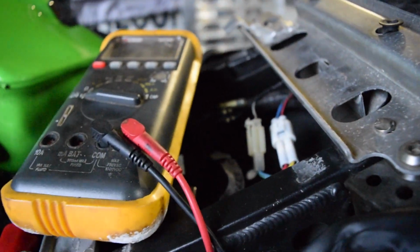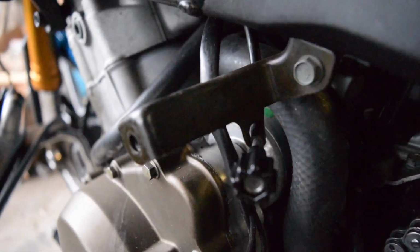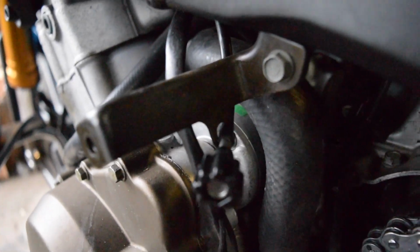Just gonna put the switch on. I just have to solder a wire there and maybe ground it somewhere around here. The switch here, on off. Got some wire here. So I'm gonna wire it from here all the way down to where the idle adjuster is, and I'm going to put the switch there because it'll be easier to access. And then from here, there's an OEM ground cable, a ground wire there, so I'm just going to go from here to that ground wire. I'll just unscrew it, tie the wire around it, and it should be sweet.